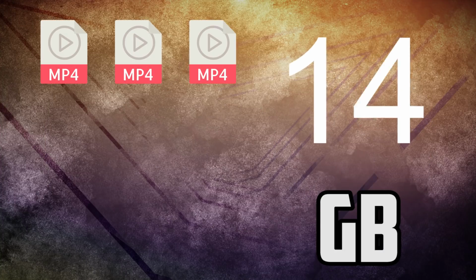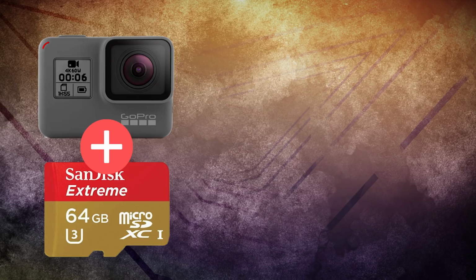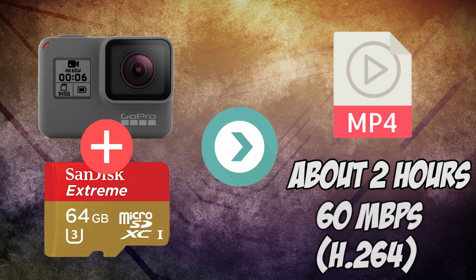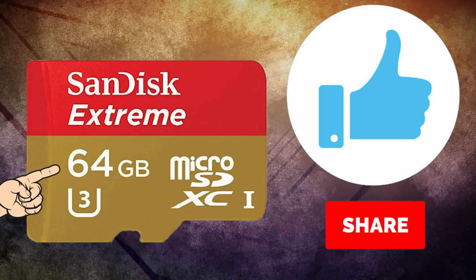Moreover, while recording 4K, your footage takes a lot of space. For example, it's possible to record about 2 hours of 4K footage using a 64 GB microSD card. Take into account that the bitrate of the video is about 60 megabits per second and the codec is H.264. It depends on the situation, but in my opinion, you shouldn't buy a card with a capacity of less than 64 GB.